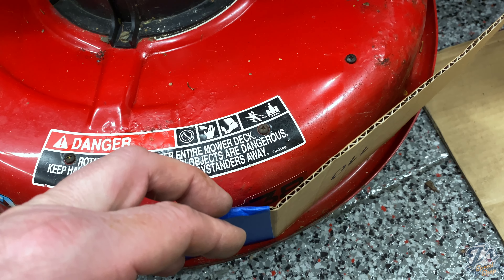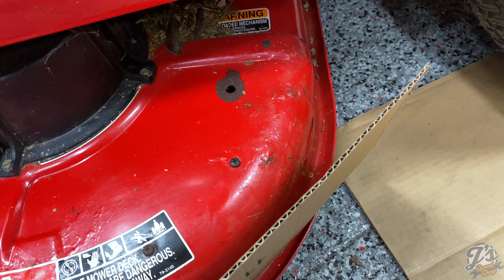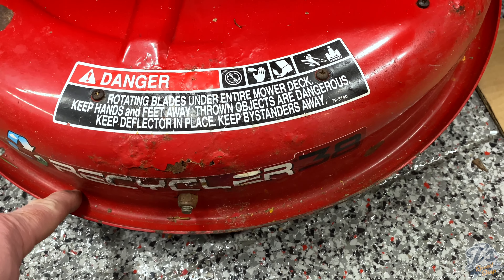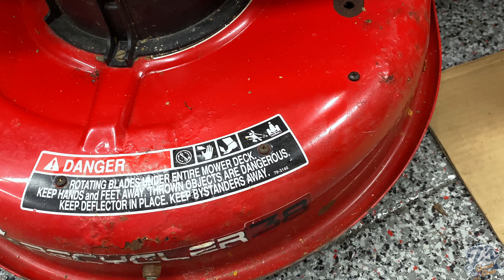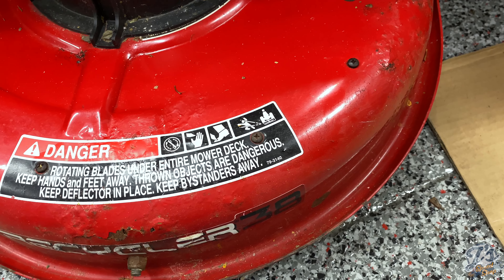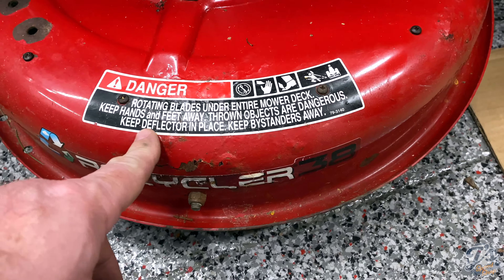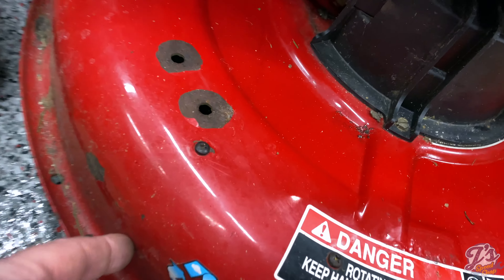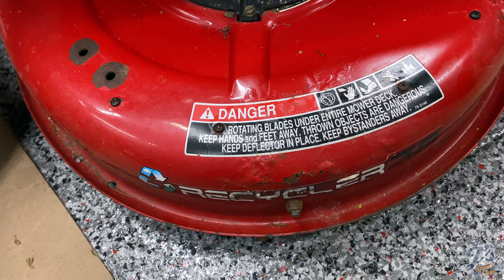I think if I can get down into the seam and clean it up, maybe weld it up where it's still pretty solid - it'd be good welding practice. The thicker steel would be better if I can get it to bend the way I want. Once I start grinding, I'll see how much metal is left - I definitely have a hole there and definitely a little bit of a hole here. This stuff up here doesn't feel too crunchy, so maybe we can clean it up and paint it and it'll hold on for a while.